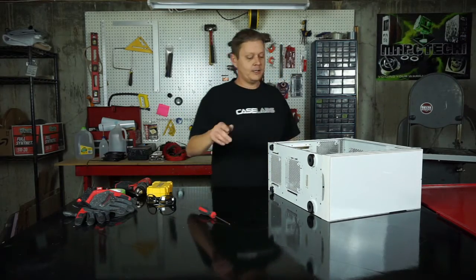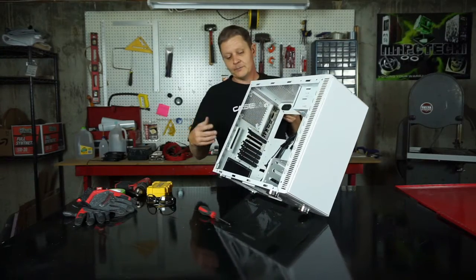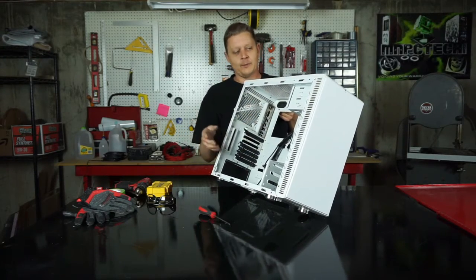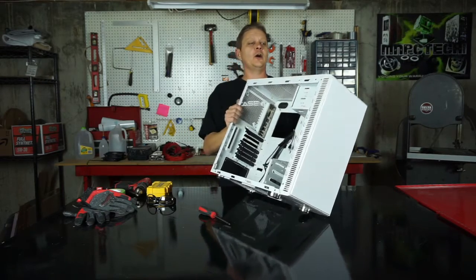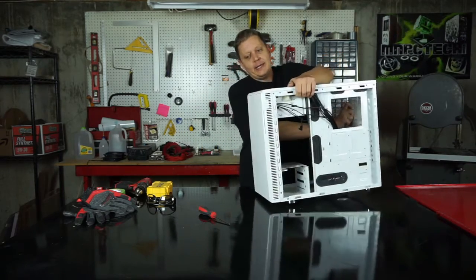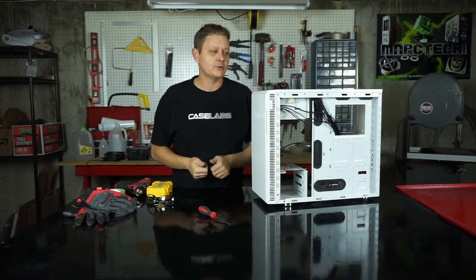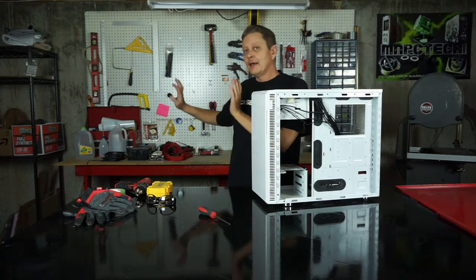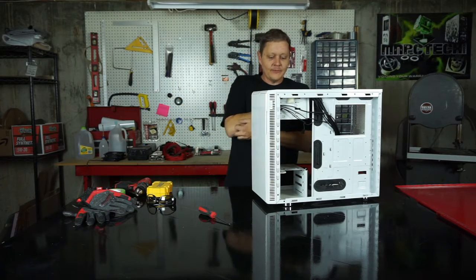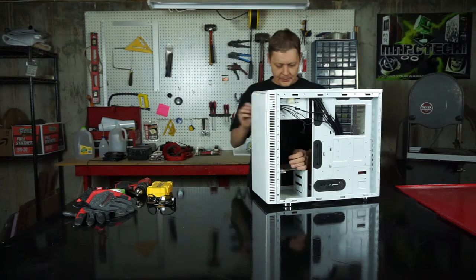And you'll notice that I have emptied all the hardware out of the case. Front screwing things, that's not important, but when we start drilling rivets and aluminum starts flying around, you don't want to have any hardware in here that might get a metal shaving in somewhere and short something out later in the future. So best bet, pull it all out, set it to the side, get it away from this. So we got 2 screws on the top here.